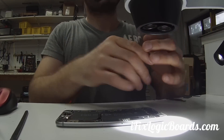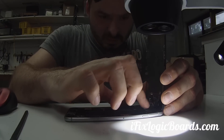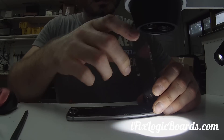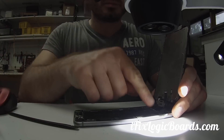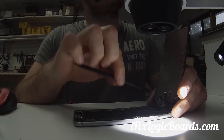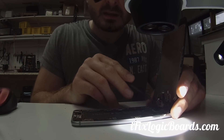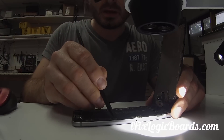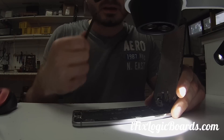The next thing I want to check is: is the booster working? So I'm going to have the battery plugged in and plug in the screen, then power up the phone. I'll let it boot up and then unplug the screen. Because when the screen is on and you unplug it, it will still send power thinking the screen is plugged in. That way I can tell — is there VBAT around 3.8V, or is it going to jump to like 15 to 20V? That's where it should be.